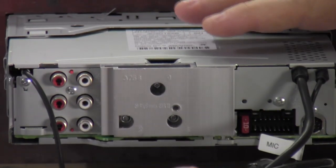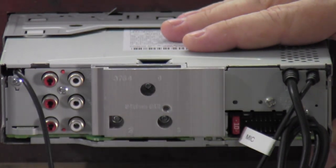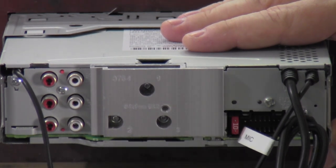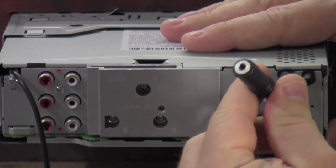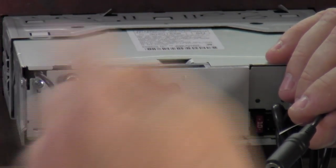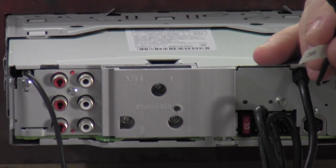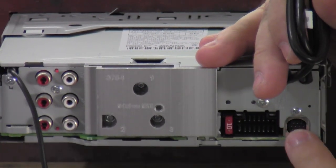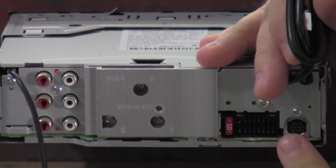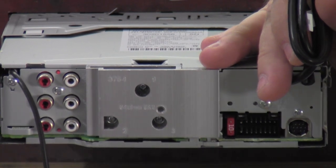You can pop out the dust cover — if your install kit has a pocket you can drill a hole and mount it underneath, or let it hang under your dash or in your glove box. This cord is for the rear USB. Next here is the port for the microphone — after you mount your microphone and run the cord, just plug it in so you can talk wirelessly. There's also a little round port for satellite radio — this radio is SiriusXM ready and you purchase an optional module to subscribe.